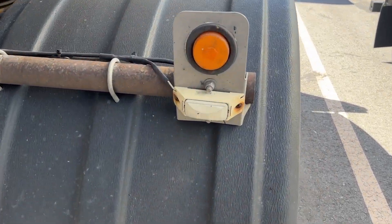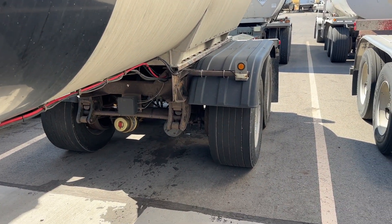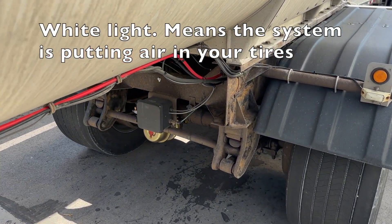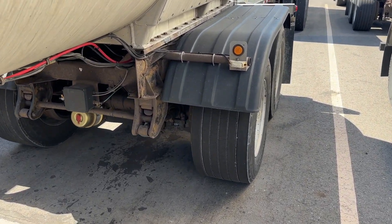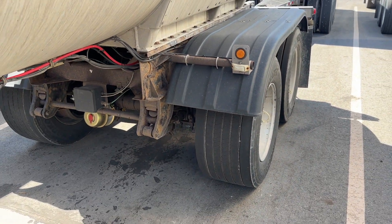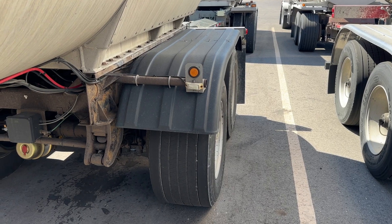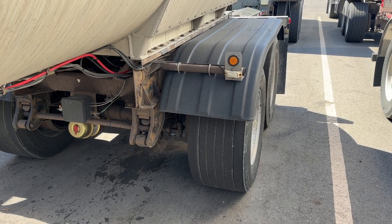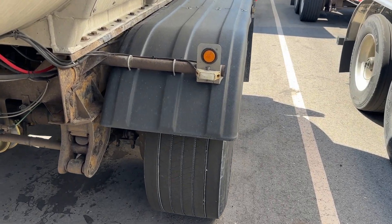Let's talk about the white light — what does it mean? On a dry van it's probably mounted on the fender or up on the front of the trailer. It can be mounted wherever your mechanics or the factory put it. The white light means that the tire inflation system is pushing air into your tires. So if you just hooked up to a trailer and this white light comes on, it means one of the tires may have a slow leak. Or if you've been driving and the light comes on while you're moving, maybe you just picked up a nail and the system is putting air into that tire. The white light means: hey, you might need to look for a leak somewhere.